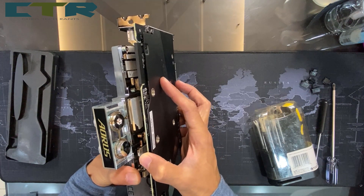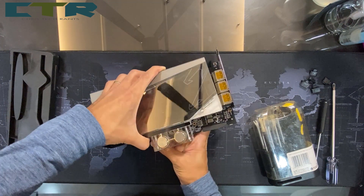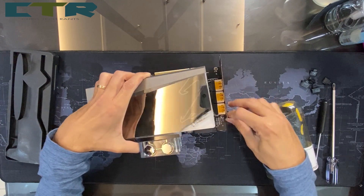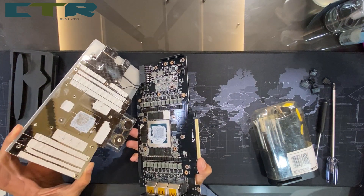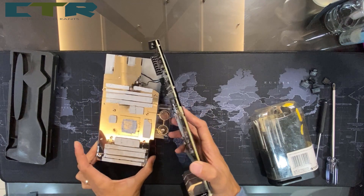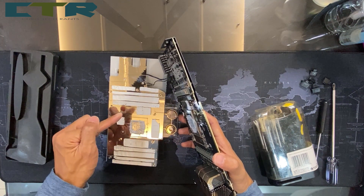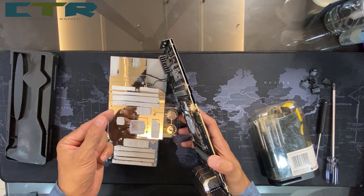There you go — now I'm holding it the wrong side up. There you go. Some of the pads got misaligned and some ripped off, so again be very careful taking it apart. Better make sure you have extra thermal pads with you — I'll be giving you their sizes shortly.